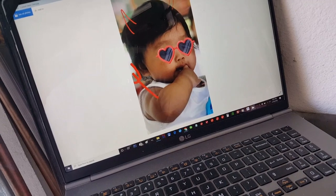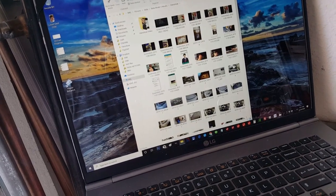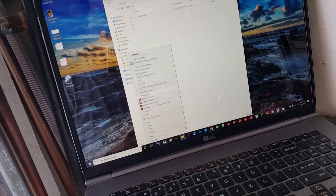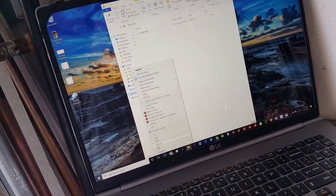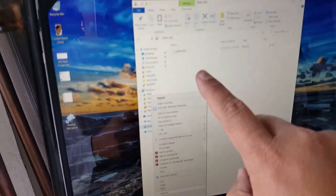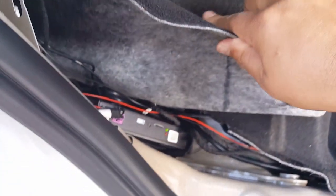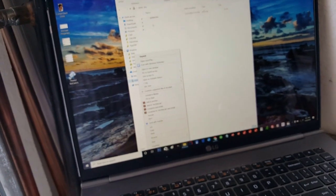Very cute baby. All right, so we're at Hansshow, and the SD card's here. So let me open that in a different folder. By the way, when they sometimes give you the SD card in the update, they don't rename it for you. The reason is not that it's going to interfere with anything. It's that they want to let you know what the archive version is before you rename it and change it to update.bin. The only reason you have to rename it to update.bin when you put it on the SD card is that the controller box doesn't know how to read any file name other than update.bin. So it's actually for the controller box. But for your own reference, they send you the update pretty much in the raw format, what it's supposed to be.